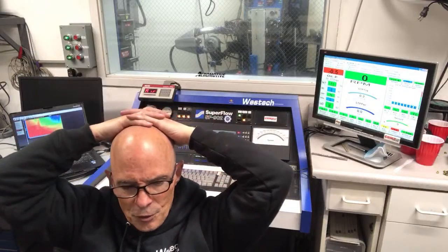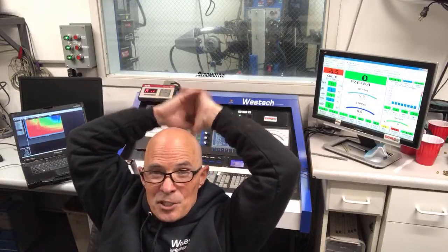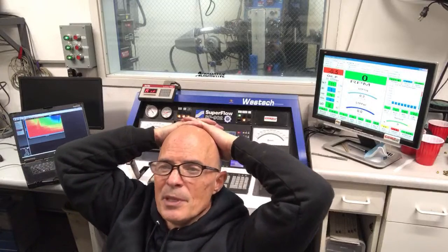The GT35 should do 30 pounds. Yeah, it should flow enough to do that. I'm not putting in a project car, I'm just doing a dyno series on it. JPL, 1 point of static compression should be worth about 3 or 4% of whatever the NA power is. The turbo is a GT45, just an eBay one. Okay, it's the NIC cam from ZZP. I didn't know what the name of it was.